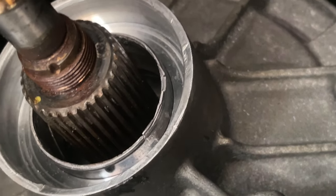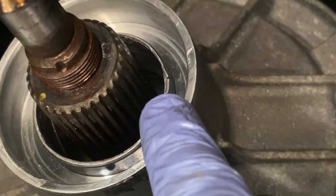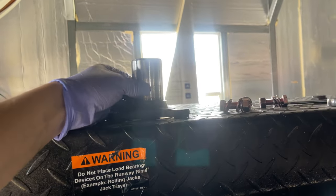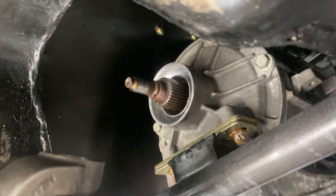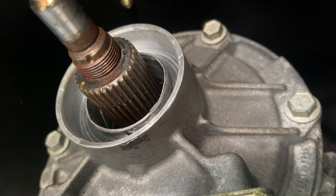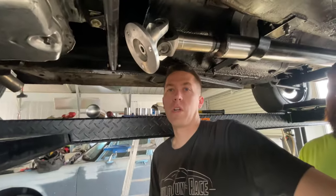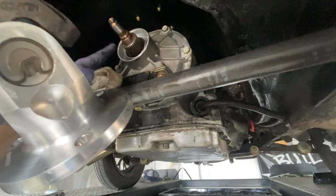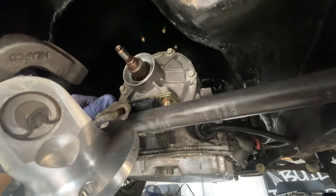Well, I may have a problem. There's a little lip right there starting to knock it out almost — you can see where it's cracked at the bottom and it's starting to fold it out. I don't know if it's from this piece starting to wallow itself out, probably from the driveshaft play or whatever, but that's probably what's killing the seals for sure. We cleaned that area up the best we could, but it is starting to crack the little tail housing.